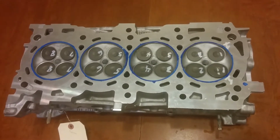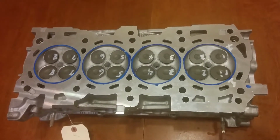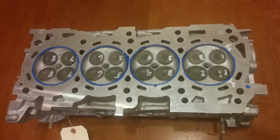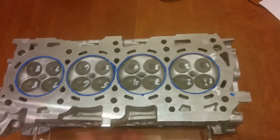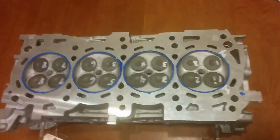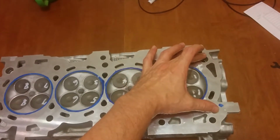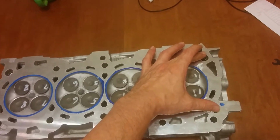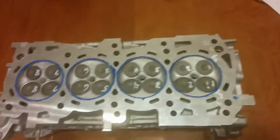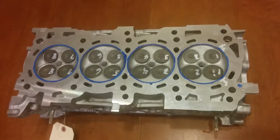You are going to need a 10mm wrench, or excuse me, socket and ratchet and an extension to take off the caps off of this side, remove the cam cap bolt on the end, you know, that holds the large cam cap over the very end of the cams near cylinder 1. And that being said, you are going to need a spring compressor of some sort.